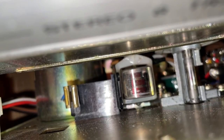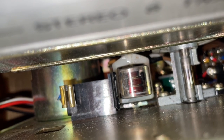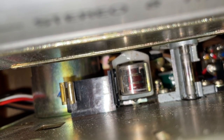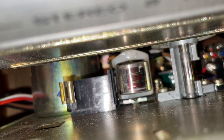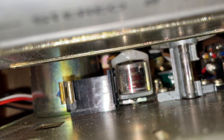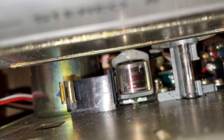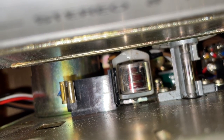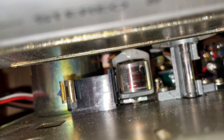Okay, so let's take another look into the 8-track player. If you have a portable, like my Panasonic portable TNT type player, it does not have the ability to switch tracks automatically because there's only like a 10 or 12 minute loop of tape in there. So to fit a whole album or two, you have to be able to have multiple tracks going simultaneously, or program. So an 8-track tape has 4 stereo programs. And the head moves up and down. By the way, I did solidify with glue that head shell, that plastic white head shell, so it will not break. Thanks for the tip on that.